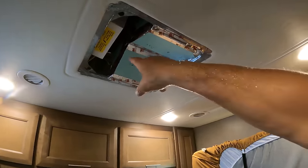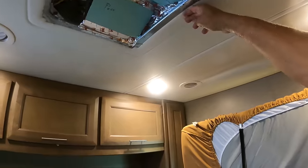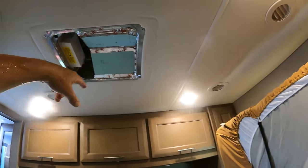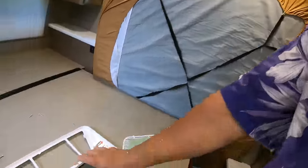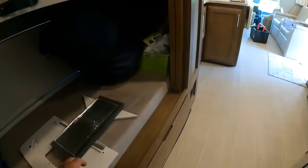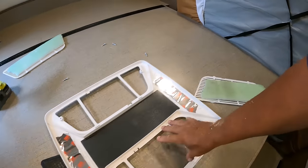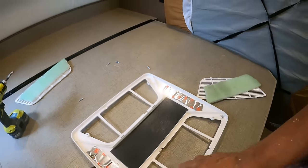But now the air stream is split into two, and it flows into the ductwork. No longer do I actually need those downdraft vents, because I'm getting enough air coming out of the ductwork system now that it actually is working the way it's intended to work. And I've eliminated that plate. So the inner plate is gone. And I won't be using the downdraft vents. I'll have use of the whole intake side, and I'm gonna put in better filters so that the air is actually cleaner, and all of this will make the AC units last longer.